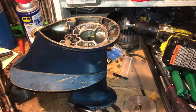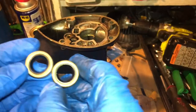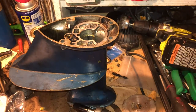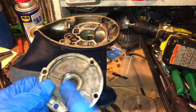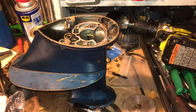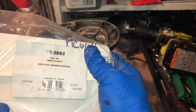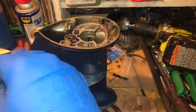The seals in the kits were slightly over the outer diameter, so the new seals fit really nicely where they're supposed to go. They were close but just looked bigger — that's why I broke my original plate: I tried to put a too-big seal in. Got the right ones now. The kit for this 10 horsepower — the 59s — there's only a couple that fit. Sierra number 18-262.